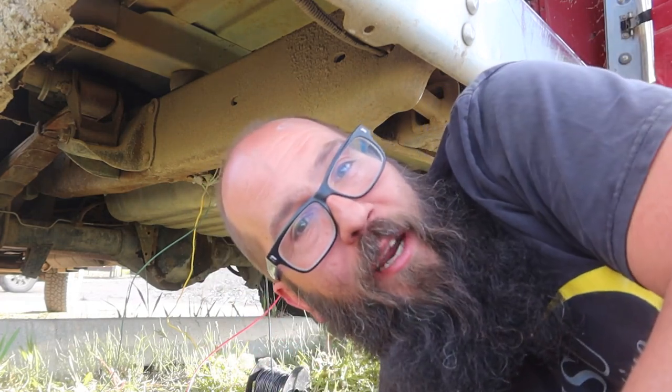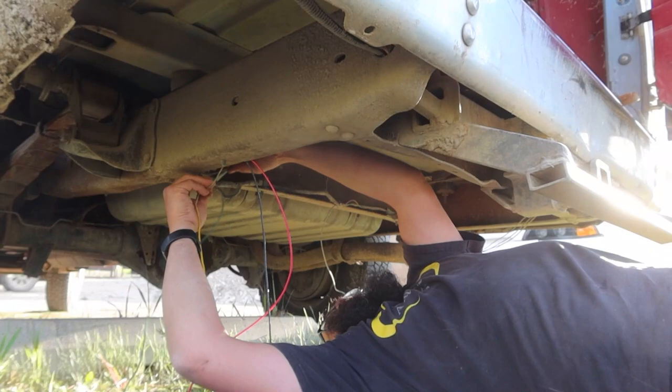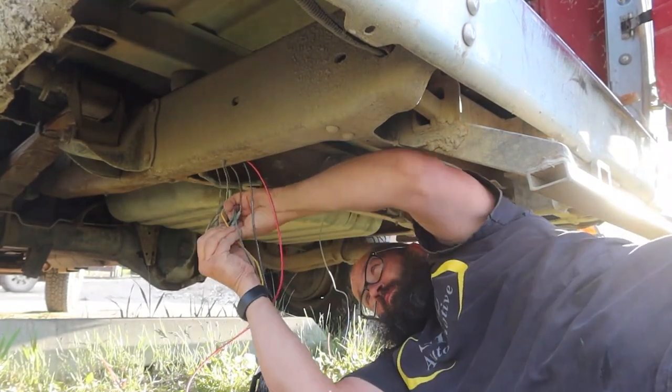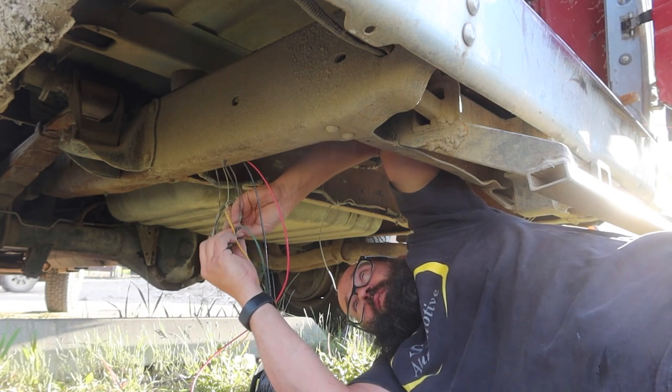I just have this to do in the back. I thought I could reuse the left turn, right turn, and taillight brake connections since they all worked in the old connector, but I found the scotch locks where they had connected them. I'm going to cut those off and use crimping seals to keep the weather out. Here in Colorado it probably doesn't matter much, but in Minnesota you'd get one winter — about halfway through winter it's done. And there's no corrosion in there, which is just amazing — it's not a Minnesota truck.